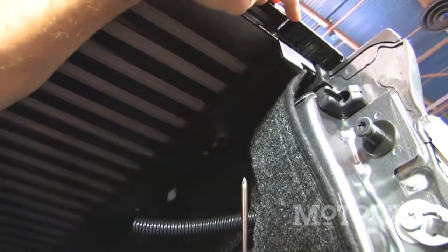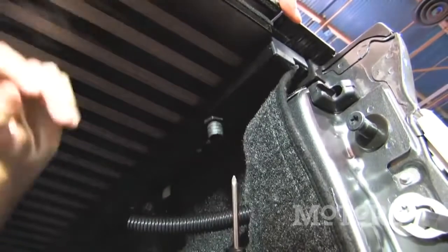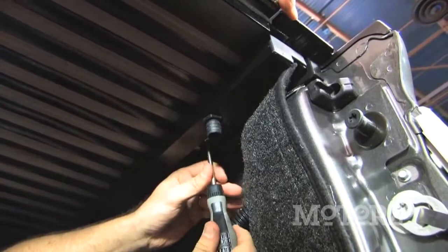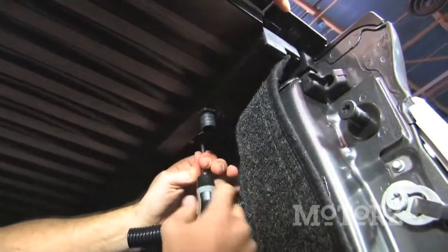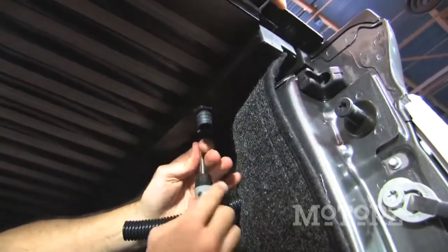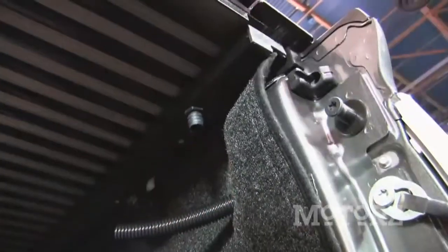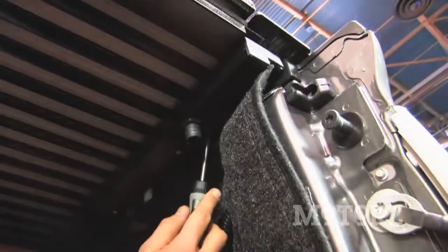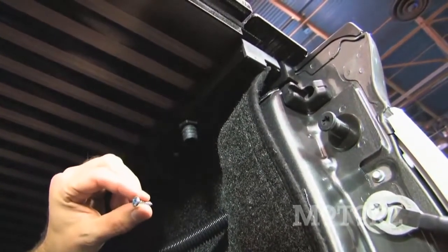You'll notice that the cover isn't flush with the side rail here, so you're going to have to pull that forward — have a buddy pull that forward for you. There's a lock block adjuster underneath here with a Phillips head screw — loosen that up, and then there's a little slide plate. Just loosen that up a little bit and then slide it forward until it stops, and then tighten it back down. To secure it in place, there's another spot right in front of that screw where you've got to drill out a hole and insert the supplied Phillips head screw.